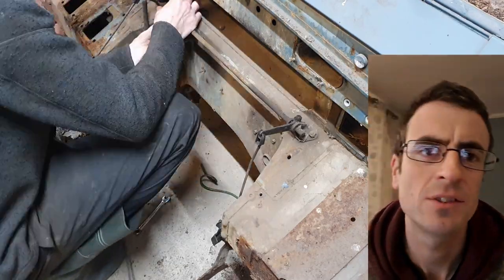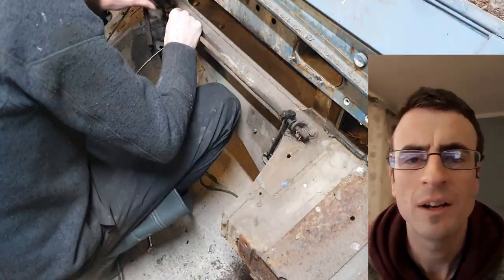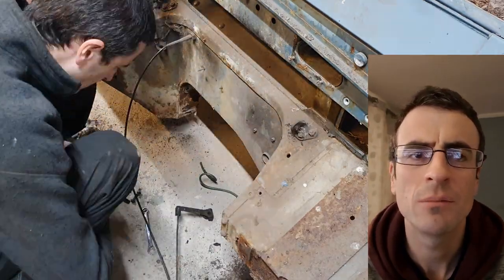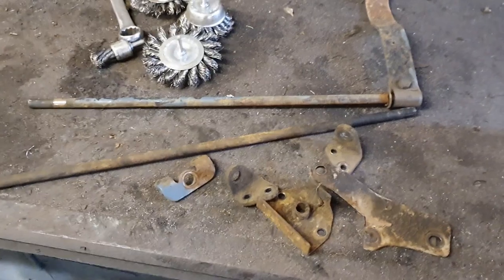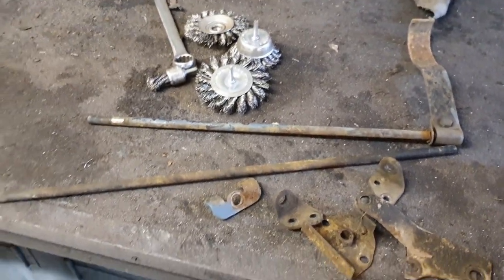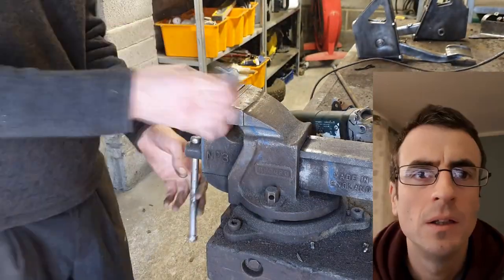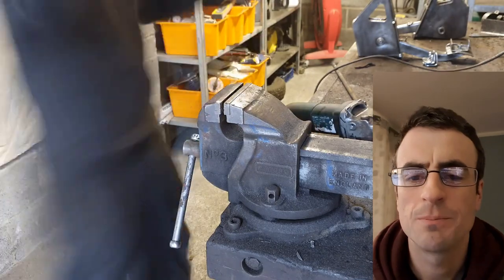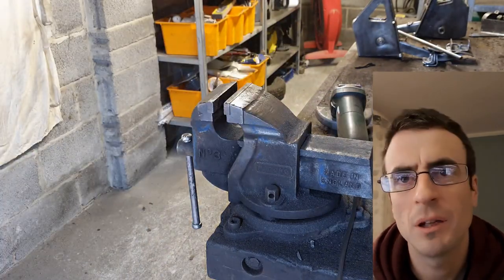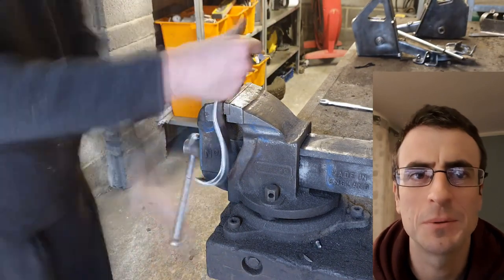Next is the accelerator linkage — that's got to come off. I left it on until the last minute because it's fairly complicated in terms of angles and things, so I took a few photographs and made sure I knew how to put it back together before stripping it off. There are a few last things for the throttle linkage that need painting. These are a collection of small parts that make up the throttle linkage — going from the pedal through the pedal box, out up high across the bulkhead and back down towards the carburetor.